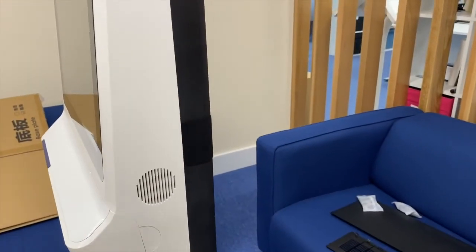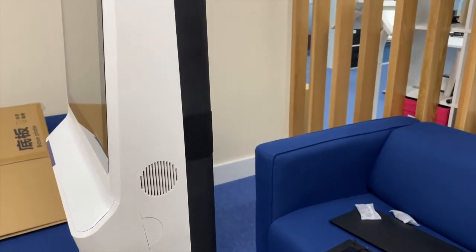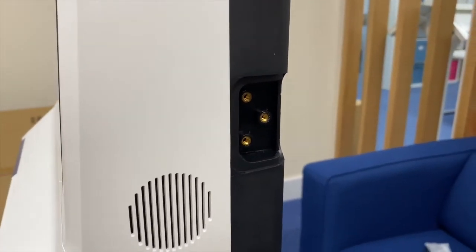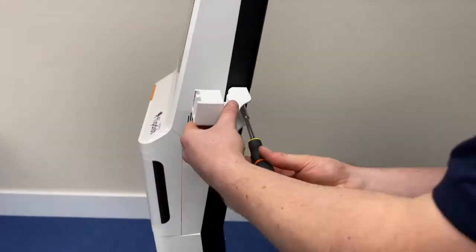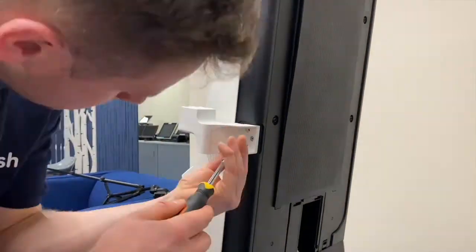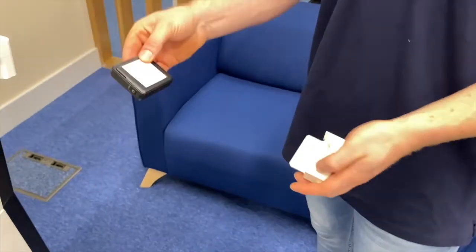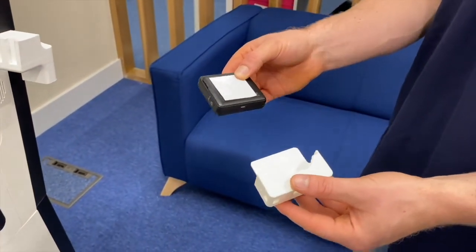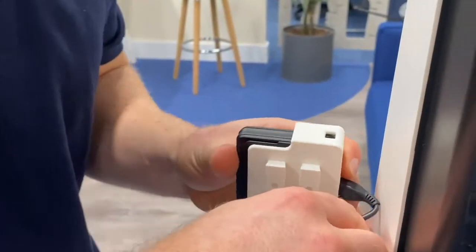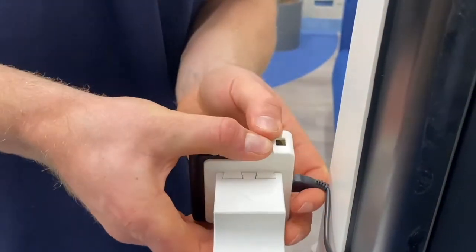Now let's attach the mount for your card reader to the K2 kiosk. Using the clip, remove the black cap beside the speaker on the right side of the kiosk to expose the three screw holes. Secure the card reader arm to the kiosk using the three screws provided. Then apply the sticky pad to the back of your card reader and insert it into the card reader cradle — this should make it hard to remove. Then plug the charging cable into the card reader and slide the cradle into the card reader arm. You will hear a click when it's correctly in place.